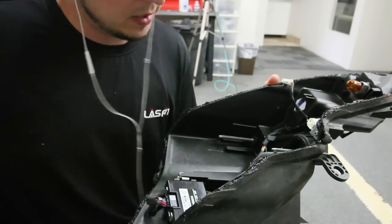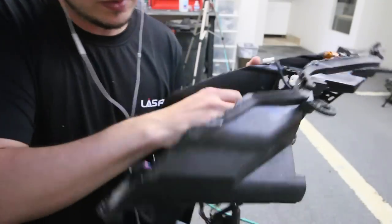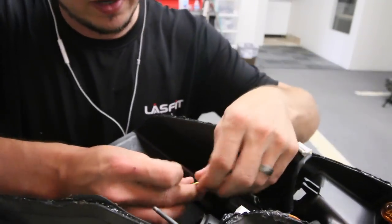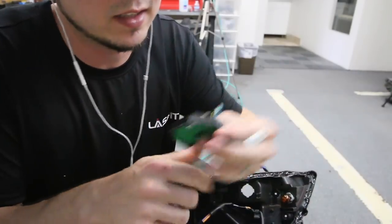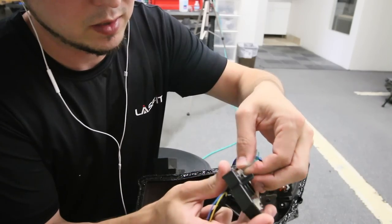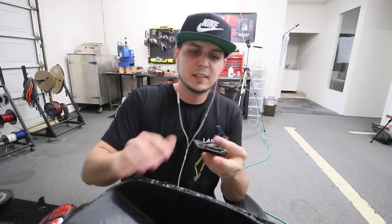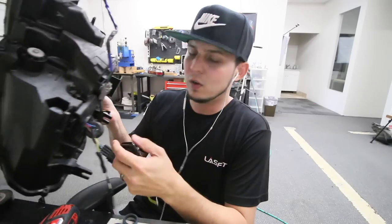The first thing I want to do is take out anything that I don't need. This driver is what powers the stock lightning bolt — it's clearly not being used because we've replaced those LEDs with the color-changing ones. This stuff is worth hanging onto because it can save somebody's butt later if they made a mistake inside their lights. Originally this had a ghost module dangling out the back, way down and around, and the tires on a GTR come right back to about there — kind of sketchy. So now all the wires are going to run straight through this OEM wire grommet at the bottom, which means the module has to be mounted inside the headlight itself.